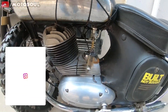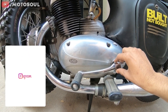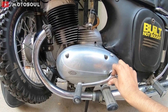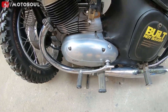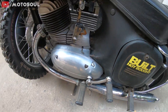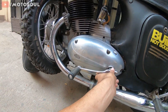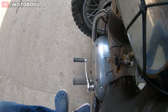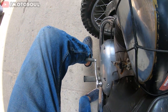Let me show you the best part of the old two-stroke Jawa — the kick start. The new Jawa doesn't even have a kick, but this is what makes the old Jawa truly beautiful. This same method applies for all Jawa ESDs — 250s and 350s. The kick lever and gear lever are the same component: you press it in and roll it back and it becomes the kick. After kicking, it returns to being the gear pedal. If you're new to Jawa motorcycles you can use it by hand; otherwise press it and it flips to the back side.